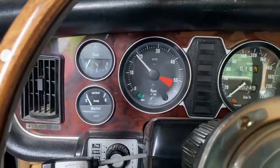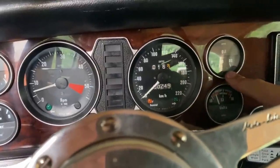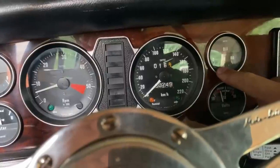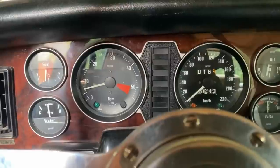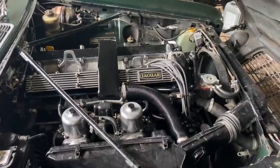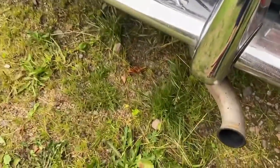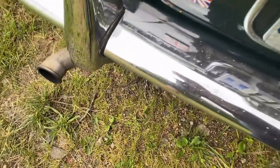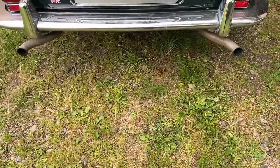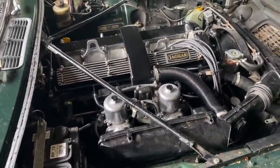Firing it back up. We're pretty much up to temperature. Oil pressure was down around that line at idle. I'll check the time now and report back in about 15 minutes. It's been about five minutes, running nicely. I've held up the revs at about 2,000 RPM for a little bit and back here we have no smoke anymore — all of that has cleared. We have nice strong exhaust pulses so it seems to be running well. Just going to prepare a drainage tray to drain out the oil. 15 minutes are up, still holding good temperature.